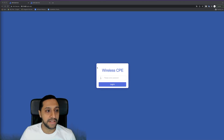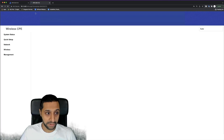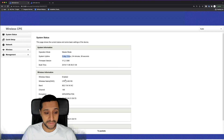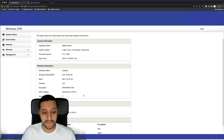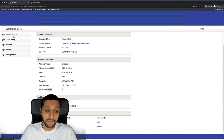These are the two devices I have set up — you can see at the top there's .42 and on the other side .43. Logging in with the default password 'admin', you can see the two devices. The .42 is in master mode, it's been up for 25 minutes, it has a wireless SSID so you can also connect to it wirelessly, and it shows you how many associated clients you have. You can keep the SSID the same as your home network or give it a different one — it's entirely up to you.